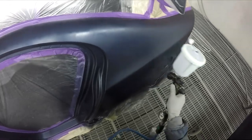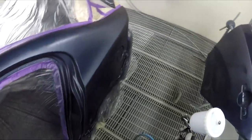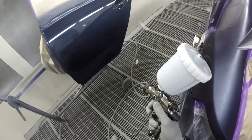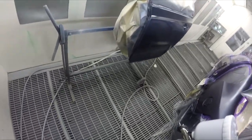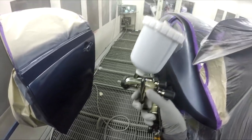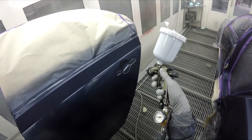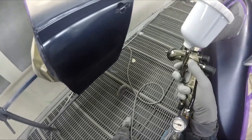I think this was actually a pretty reasonable size repair on this quarter panel. The quarter was knocked right in, it was right on the line, so you kind of need to spend a bit of time getting it to look right. It blocked down quite well though — that quarter panel was pretty straight when I blocked it down. This door here, he'd actually left too much body filler in the door, so I ended up completely blocking through my primer and blocked half of his body filler out of that section, and then the UV primer to the rescue once again. I mixed up 400 mils of color — including reducer — these days I've actually been mixing up my base coat colors RFU, which means ready to use, so thinners included — 400 mils including the thinners.